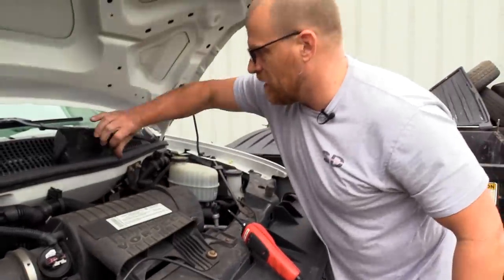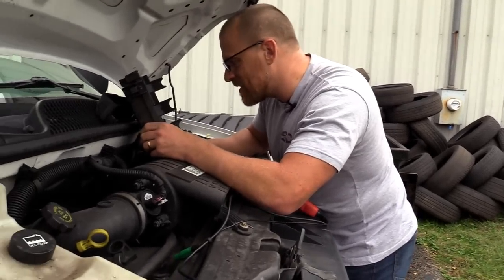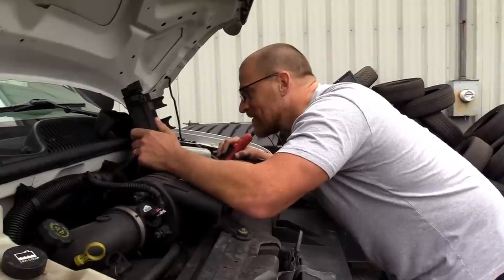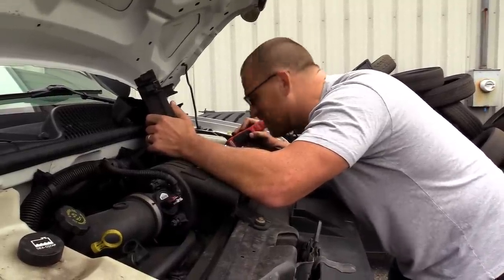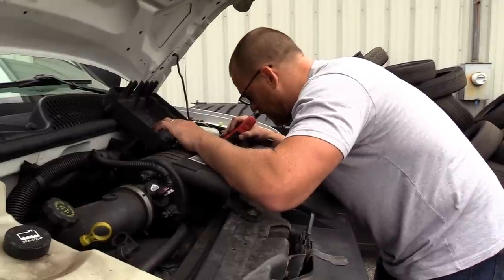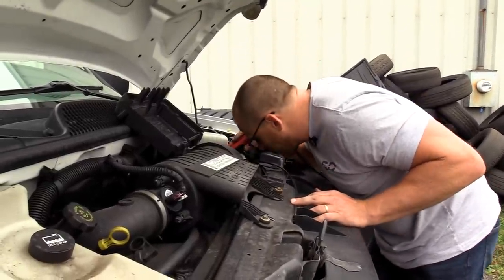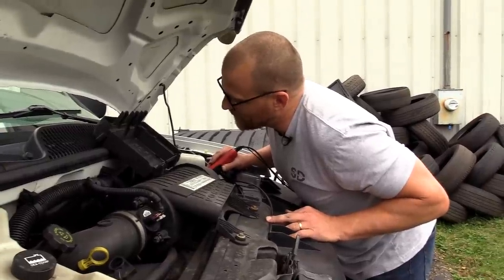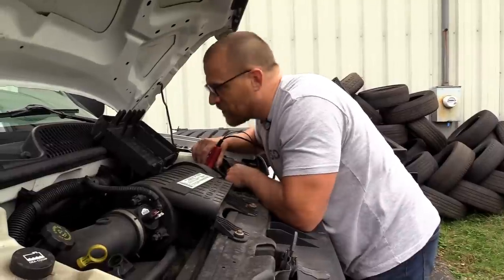It might be a good thing Danner didn't order a BCM for this because we have a power feed that we're missing. Fuse 23 - BCM 6. Caleb and I are laughing because we just did this on a Hummer - you guys will get to see it here soon. The layout of some of these fuse boxes. Counting 1, 2, 3 - it's missing. Are you sure it's not upside down? It is empty. It's fuse 23 - that's BCM 6.